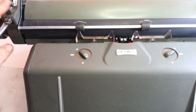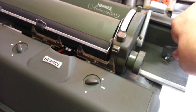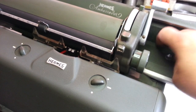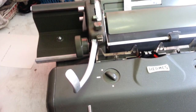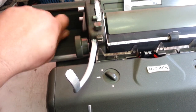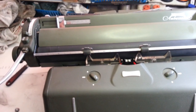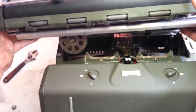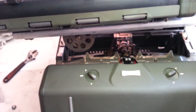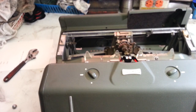This also has the quick carriage release. Let's take that off while we're doing a demo. Some of these have latches; this one's got little nuts on each side. The carriage comes off — it's a little big, a little awkward, and you've got to watch it because it wants to get away from you when you open it up. You can't even get it on camera it's so big, but you've got to watch that mainspring — it wants to go to the margin. Get the whole carriage off and find somewhere to put it.